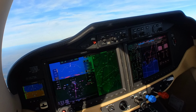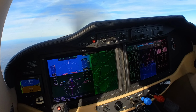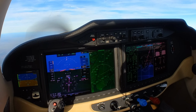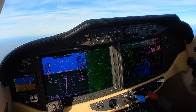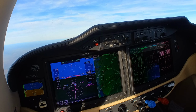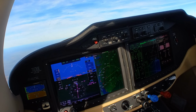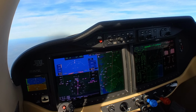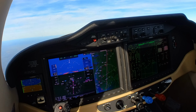It's quite a setup. Up in the top part of the panel, you can see that we have the autopilot, along with all of the backup push buttons that I need for radio and direction, plus the altitude set and vertical climb and descent and barometer and all those things. And they're very, very easy to get to. It's kind of like a jet panel. This is the new modern layout that puts everything right in touch and right in your sight. And way over on the left, you'll see a small backup flight instrument, in case for some reason the two main displays go out. You have a battery backup display, at least to let you keep the airplane straight and level and get it down on the ground somewhere.